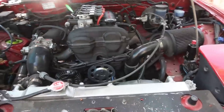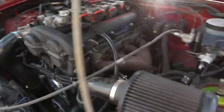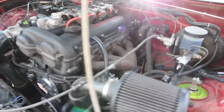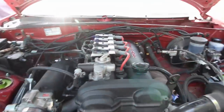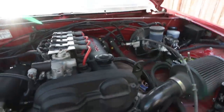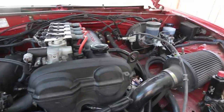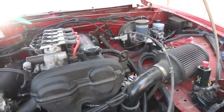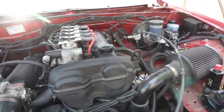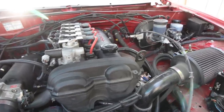If you're installing this kit on an early Miata like mine that has a cable-driven speedometer, you can just eliminate the speedometer cable because the BMW transmissions do not use one. That leaves you with a problem in that you are not gonna have a working speedometer. Now, K-Miata currently doesn't have a solution for sale, but from what they told me, they do have a solution that's pretty much ready to go. If it is available at the time you're watching this video, I'll go ahead and have a link in the description.